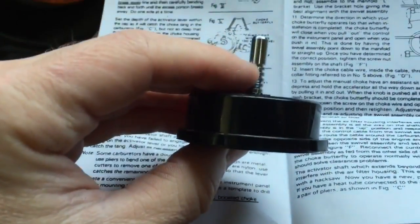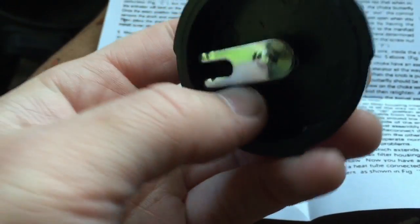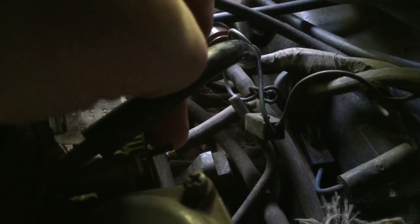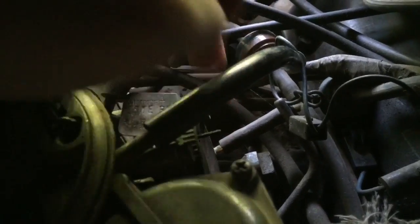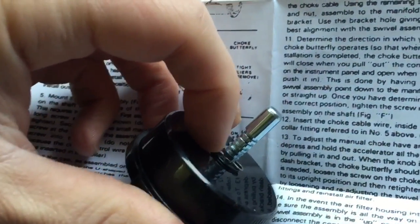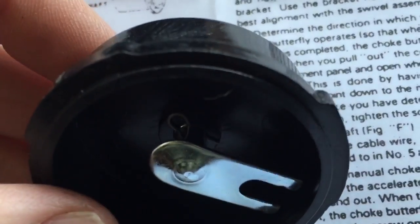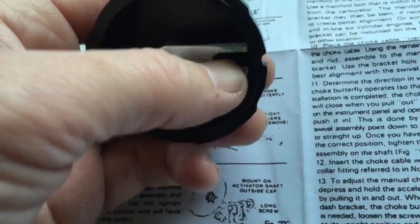Put your shaft through the cover and set your depth. This grips your lever. Once that grips the lever, set these pins — one on the outside and one on the inside. And we'll have your depth set for your forks here.